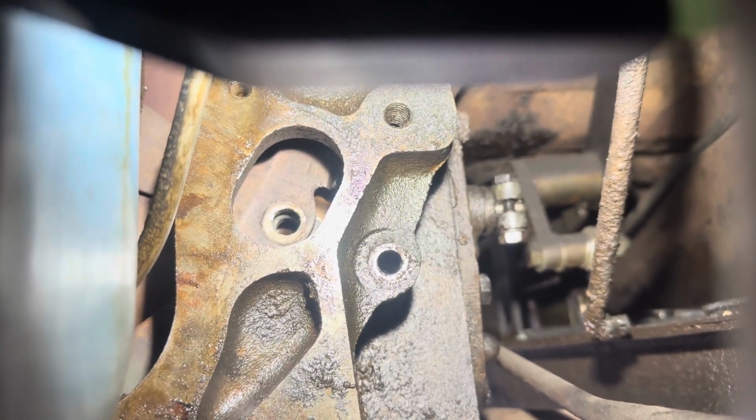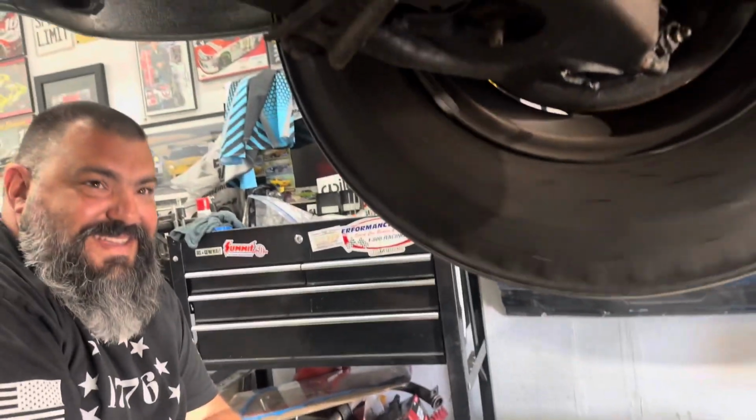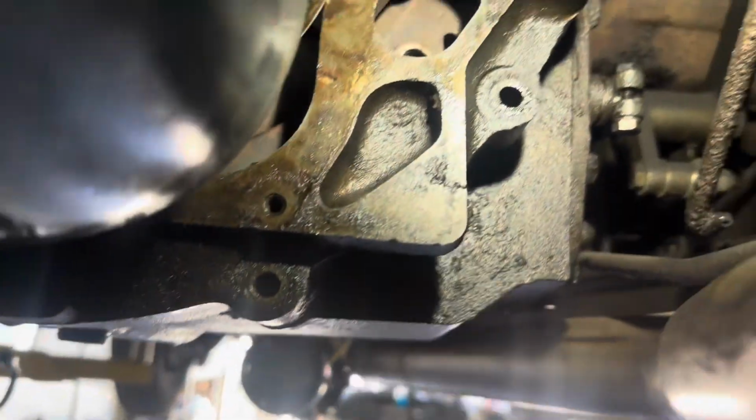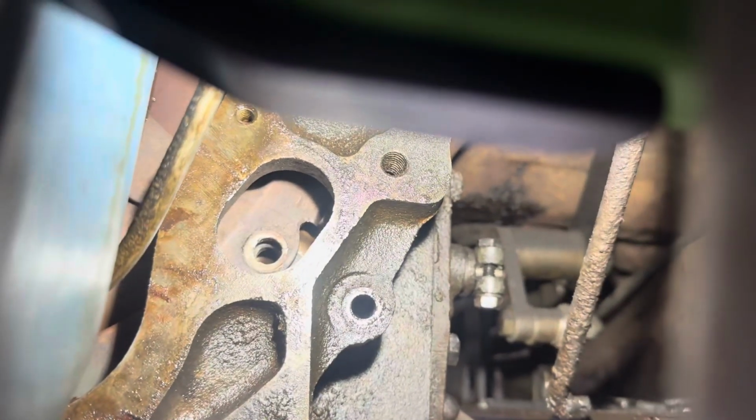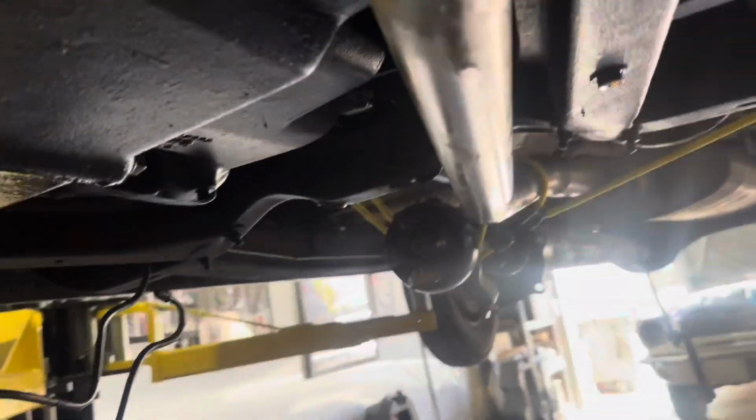Anyway, we have the torque converter bolts are out. Okay, Burnsy's having fun playing spin the wheel. What prize do I win? Nothing. You get to take more shit apart. Sounds about right. So, all the flex plate bolts are out. That's done. The bottom half of our bell housing is undone. So now we're going to do the top half of our bell housing.